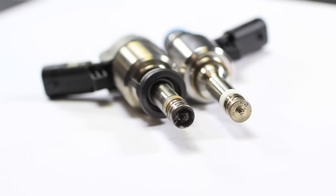While we have the injectors out, it's a really good opportunity to show you a clean injector versus a dirty injector. The clean injector — it's pretty clear which one that is — you can see some tiny little holes in the end of it. Now if you look at the dirty injector on the other side, you'll notice those holes get slightly blocked with carbon buildup. That can really affect the drivability of your 2 liter turbo. So if you're pulling the intake manifold off and replacing the seals, it may be a good idea to just clean the tips of those injectors as well.